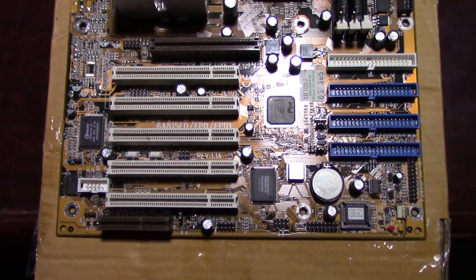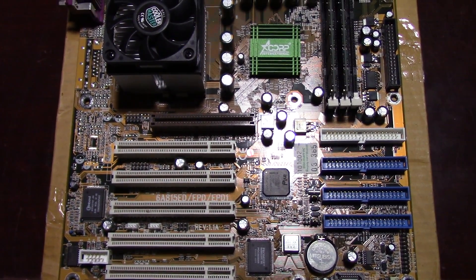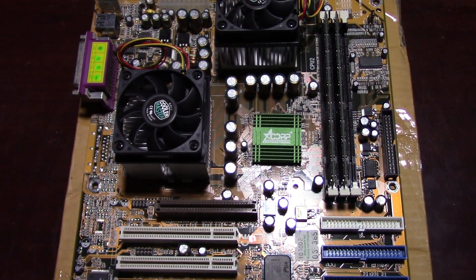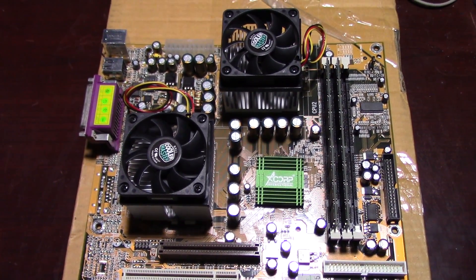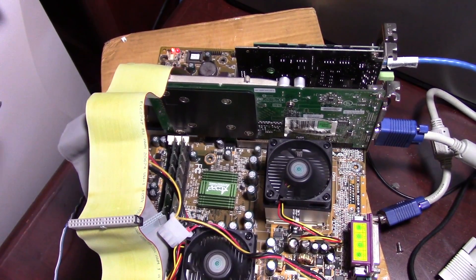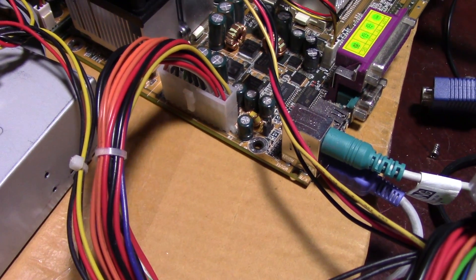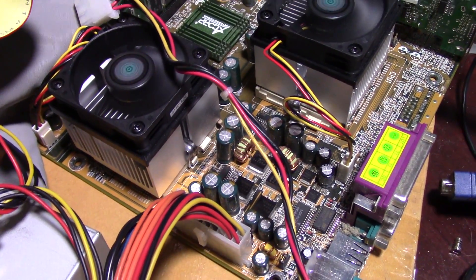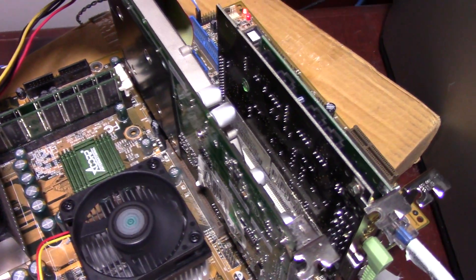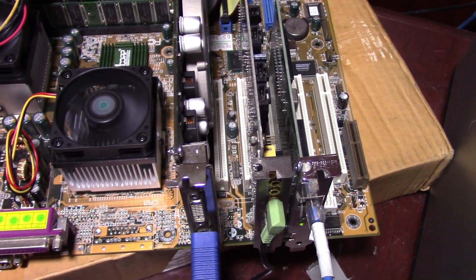The 815 EP chipset properly supports a 133MHz bus with a proper clock divider, allowing the AGP port to operate at the correct frequency. The real benefit is 4x AGP as opposed to the older 2x spec on the BX chipset, allowing higher-speed GPUs that won't operate on a 2x AGP bus, mainly due to voltage requirements. It also supports Tualatins, at least in theory. As you'll see in the benchmarks, the 4x AGP speed shows no improvement over 2x AGP. The 512MB RAM limitation is not a big deal for this era of games.